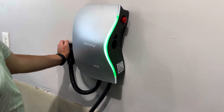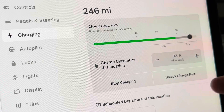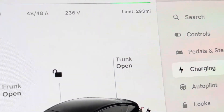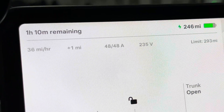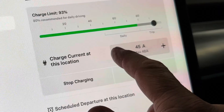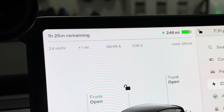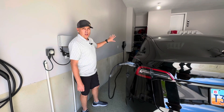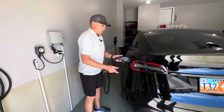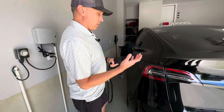Blue means it's communicating, and green flashing means it's charging — the lights match up with that. Let's look at the charging speeds. With my car I can adjust the amperage, and you can also do that with the Shockflow app. I set it to the maximum of 48 amps. Even though the battery is almost 80% full, we're getting around 34 to 35 miles of range added per hour, which is pretty good. I usually charge at around 30 miles per hour on this car. The charger's installed at the front of the car but there's plenty of cord length — about 16 feet — to easily reach the back of the car. To unplug, push down the handle and it unlocks the charge port and comes right out.